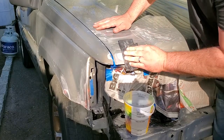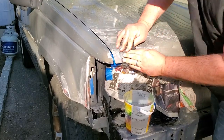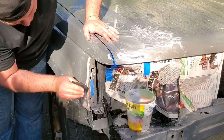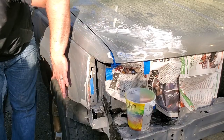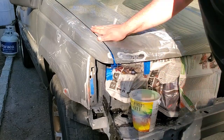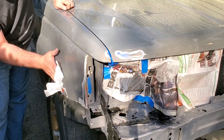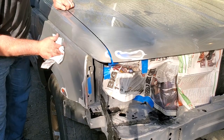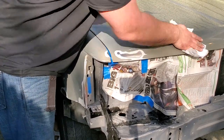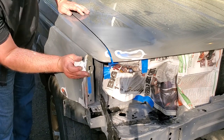I'm just going to wet sand a little bit. 400 grit on the foam pad just to bring down the clear coat a little bit so more base coat will stick to it. I went over everything I want to paint with the 400 grit sandpaper on the foam pad to keep everything nice and smooth. I'm not just doing the damaged areas — I'm pulling it back more to blend in the areas I want to paint. Now I'm wiping down everything with a paper towel with a little bit of rubbing alcohol to clean off soap residue, oils from my fingers, and any dirt on the Jeep.